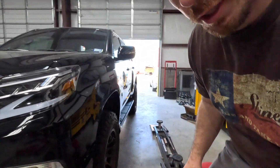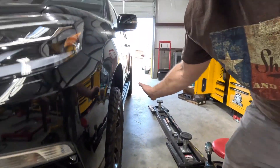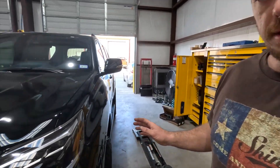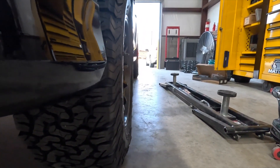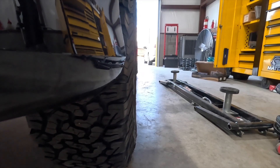If you're doing this at home and need to drive it to an alignment shop, what I normally do is set the camber at maximum negative on the lower control arms, then loosen the tie rod adjuster and look down the edge of the tire until it's basically flat with the back tire — catch a sight line. As you can see it's toed in a little bit, but if you can square it up and get it close to square you'll be in good shape to drive a few miles to get it aligned. Always get it aligned. Lock down your lower and upper control arms and the rear control arms, otherwise you're going to have cracking and popping.